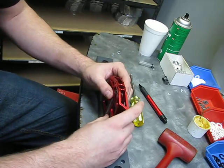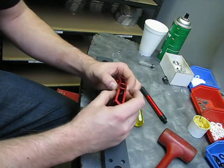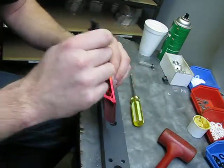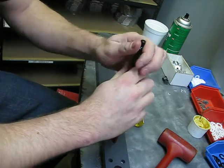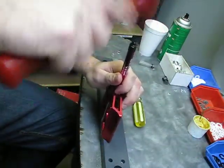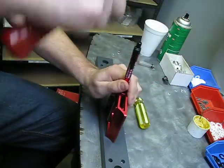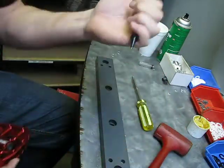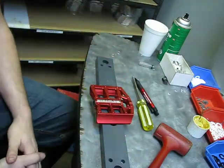But I don't want you guys to damage the bushings, because if you got a bushing kit and you're in Israel or who knows where and you damage it, you've got to get another one. So I'm going to use a pen — just a regular pen. Anything that will fit into the end but be large enough to not go through the bushing will help set it. With a little hammer, you just start it, and there we go — now it's starting to take. Hit it hard and it's pushed in as well. The pen even works after. So you can use a screwdriver, but it's easier to use the pen.